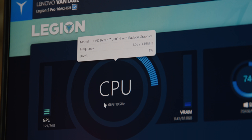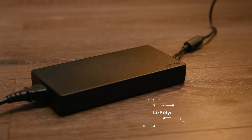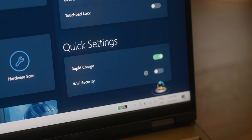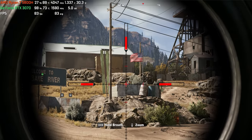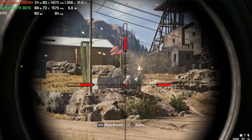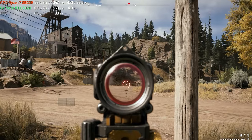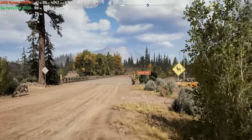Given the power of the built-in hardware and cooling system, it is clear that the Legion 5 Pro consumes a lot of energy. It is powered by a large 300W power adapter, and the lithium polymer battery has an 80Wh capacity with a rapid charge function that, according to our measurements, charges in just 45 minutes. We measured 3 hours and 50 minutes of battery life at maximum power-saving options and 80% screen brightness. Even on battery, the Legion 5 Pro delivers great in-app performance at around 60% of the power achievable when connected to a charger, though for serious gaming the use of a charger should be mandatory.